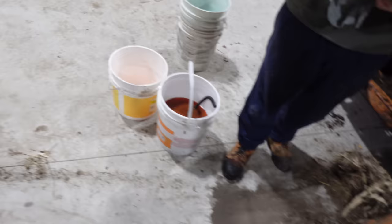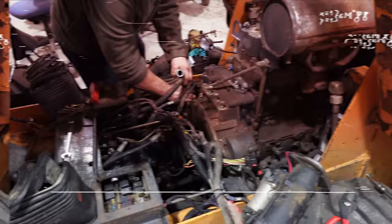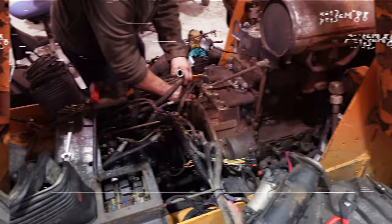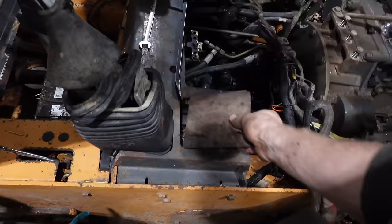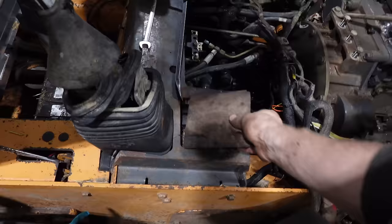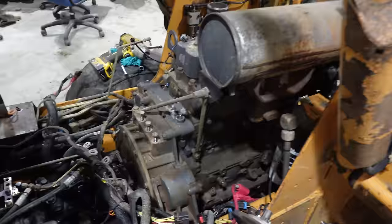Nice floors. Here we've got the four bolts that hold the pump to the plate - take those off, then the engine mounts, front and back. The exhaust looks like it's never coming off again - it's just part of the engine now, completely part of the head. It'll be difficult machining that head with the exhaust still on there.